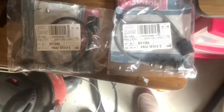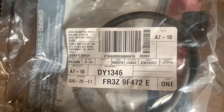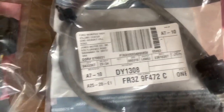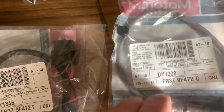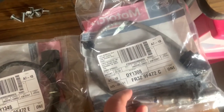Changing over two sensors — this is the part number, Motorcraft, left side and right side. The left side wiring harness is longer than the right side. This is for a 2016 GT.